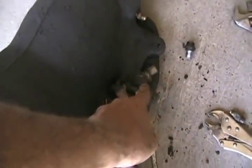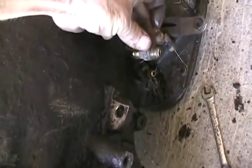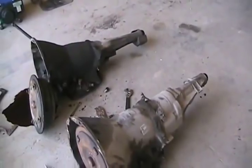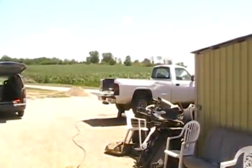I had to change over those two little levers and change over the park switch — it's a different connector now. The only problem is I can't use the same fittings to have the transmission cooler lines hooked up, because these ones are bigger. I gotta buy new fittings; they won't screw into the block. And of course I still gotta get a longer drive shaft.